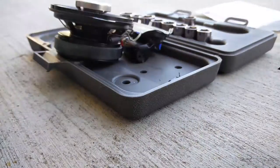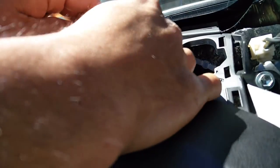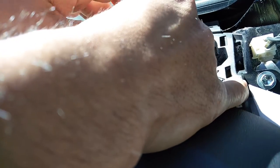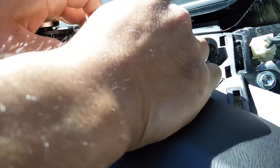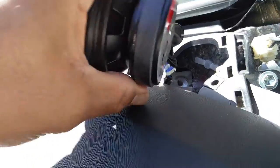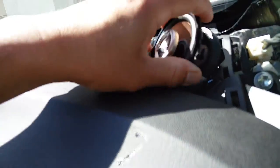Now we're going to go through the process of reinstalling it back in the dash. There you go — that speaker is ready to go back into its connector. As you can see, I just didn't want to cut the factory connector so that everything remains plug-and-play. Here I've got the dash opened up where it goes in. With the connector side in first, since it's just a short plug right inside the dash, I plug the connector into the stock connector that goes to the speaker I soldered. Now the connector gets plugged in and I reposition the speaker back into that hole.